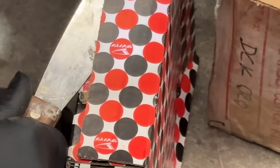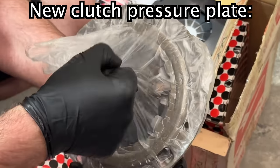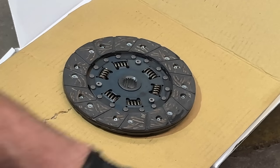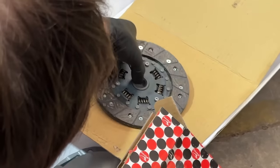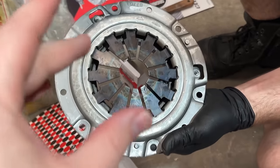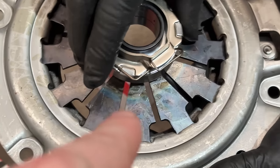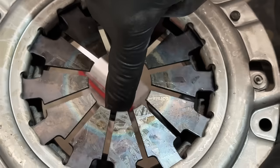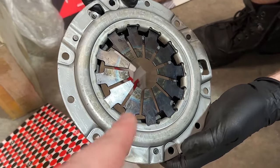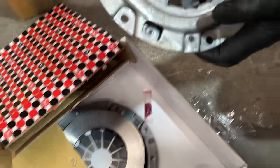Everything's in Japanese, that's fun. Yeah. I mean, that aftermarket one's good, but you know, it's a real one. Always best to use the genuine ones. Luckily, same day, found a modern clutch, not full of asbestos, so very lucky. Whenever you push on the pedal of a manual gearbox, no one drives manual anymore, what you're actually feeling is that guy rubbing up against these fingers. That's actually the spring that you push down. That's what pushes the pedal back. This is a genuine original one from way back, so the clutch pedal is gonna feel proper. If you put a different clutch in, it feels different.